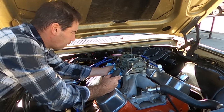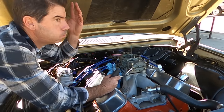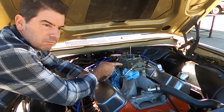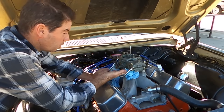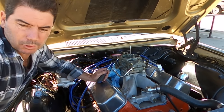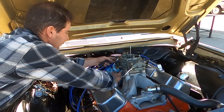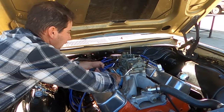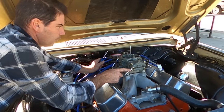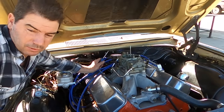That was one big backfire, one big cough. So I put these float level screws back in, get my extreme fire hazards out, and I'll just fire him with the pump on and see what the level does. I actually went three-quarters of a turn, so we'll see.